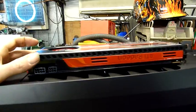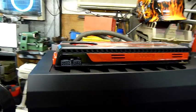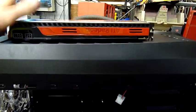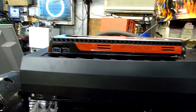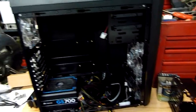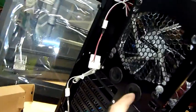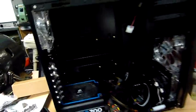The next model up, the 7970, has three big fans with a special anti-turbulence heat sink design — they clearly knew they were in trouble with these. It still works fine, it just needs saving before it actually dies. The worst thing would be letting it get cooked solder joints. I'll run it for a while to make sure everything works with air cooling, and then more than likely go for water cooling. It's even got little glands in the back to run hoses through. This thing's going to be a beast.